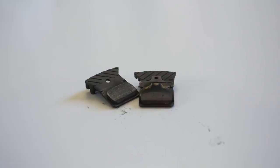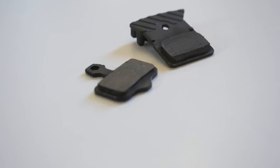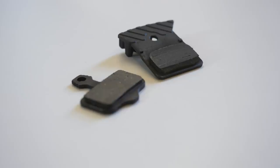Switch to a disc brake bike and you'll eventually have to choose new pads, and that is a minefield. All pads are made by mixing various powdered additives with a binding agent and then squashing it all together at high heat and pressure to form a solid block on the backing pad. Most new bikes come fitted with resin pads, made from non-metallic additives such as rubber, glass, carbon and kevlar — an all-round pad that works for most people but isn't very durable under hard use. If you live anywhere hilly or ride in all weathers, you're probably better off switching to more expensive but much longer lasting sintered pads, also known as metallic brake pads. These use a very high proportion of metallic fillers such as copper, steel and iron. They provide strong effective braking at high pad temperatures, although their bite can be poor when cold and they'll wear out your rotors quicker than resin pads.